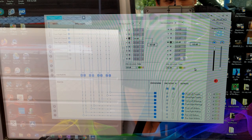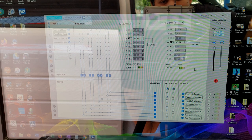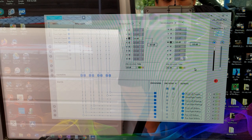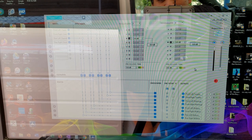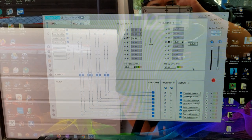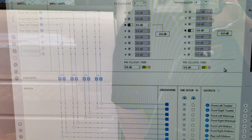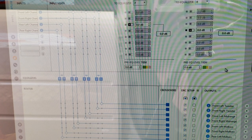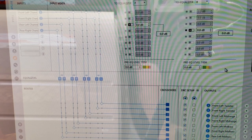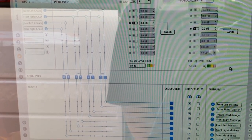The simple fix: if you're going to use these HD amps or any four-channel amplifier, make sure your inputs are set from two-channel to four-channel. Once I flipped from two-channel to four-channel on the amplifier itself, I was able to get the front and rear C7 3.5-inch drivers working, which allowed me to tune. I'm doing a 1000 Hertz at 0 dB track for the rear door speakers.